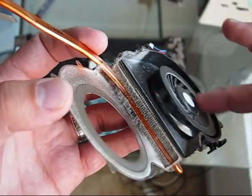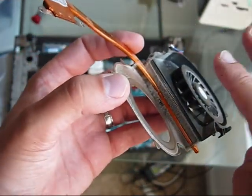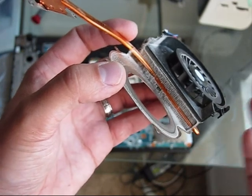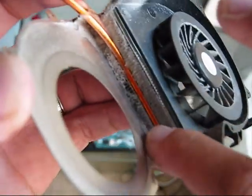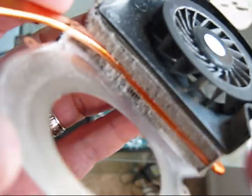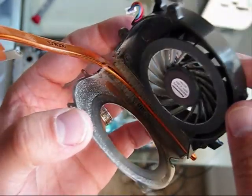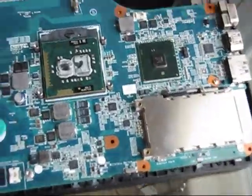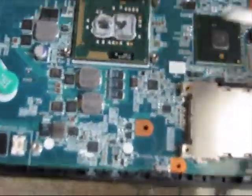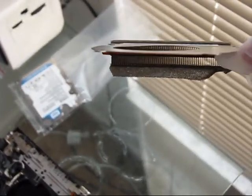Right now it sounds like this. Using a special solution or just regular water with a little isopropyl mist, rinse the fan and remove all dust. As you can see, it's very, very dusty — everything is completely clogged. Let's order the replacement fan. The heat sink is already totally clean, as you can see — it was flushed and dried, no signs of dust, totally clean.